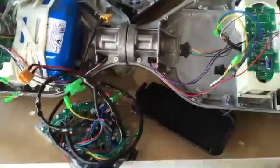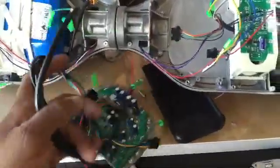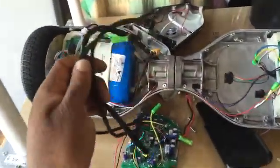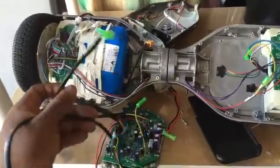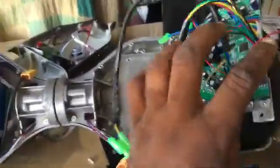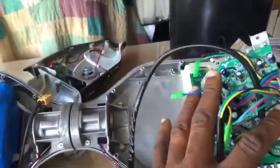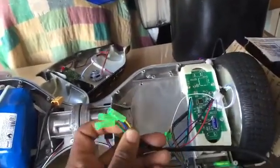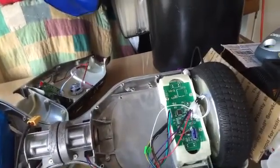Here is our new motherboard. We want to start preparing this to be installed. The first thing you want to do is run these three wire harnesses through this chamber here. These three wire harnesses are important to run first because they are the hardest part of the job. You want to place your motherboard in the area where it is supposed to go, and run these because they are the narrowest harness, to make room for the other two.